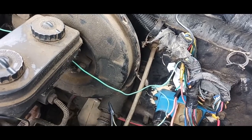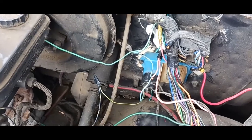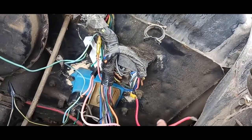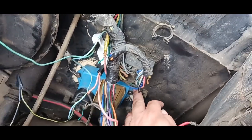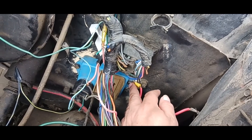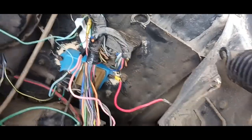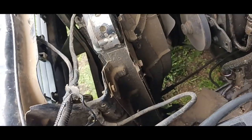I also did a lot of extra stuff, and I recommend doing it. I cleaned up all the area for the paint and I've run a ground from the brain box underneath the fender — right here — with a direct feed into the negative.